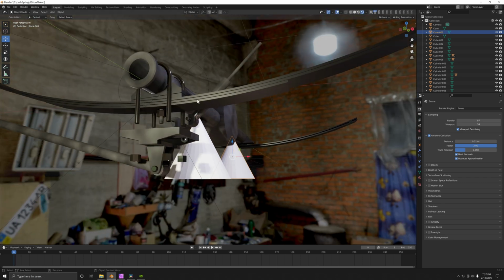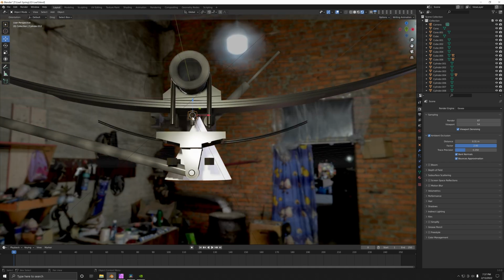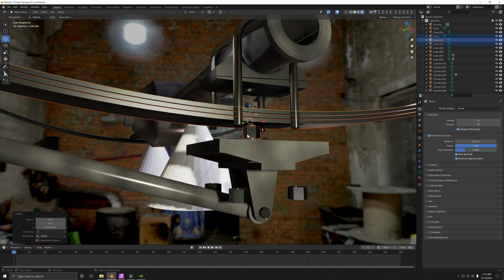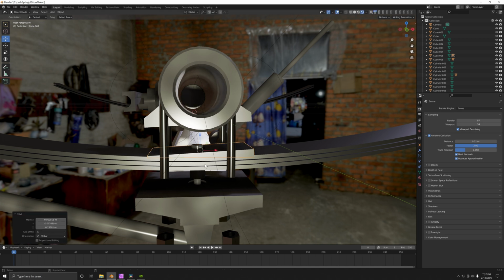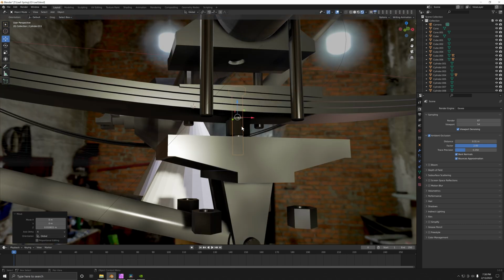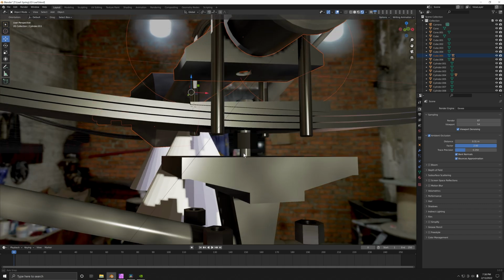And you're going to want to do one side at a time, which is why I didn't add it to this side, because each side is exactly the same. So when this comes down, this right here, and all this will then slide down, right? But usually it's going to be like this. This will slide down too. So if you have a shim, it'll come down with it because that bolt's right on top of it. See that right there? Your shim, you have this bolt right here, and it's round. It'll be round because it goes into the perch right here. See this right here? That's what keeps your perch from sliding around on your leaves.